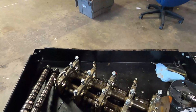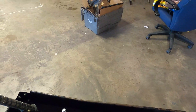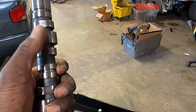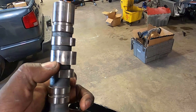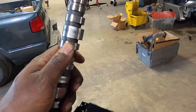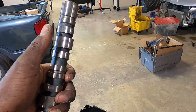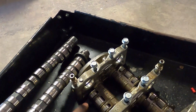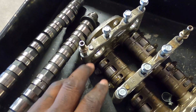For you guys that aren't familiar with VTEC — VTEC basically works off of a two or three lobe system. The lobes on the outer side are the primary lobes and this is what you daily drive on. Then once you get into a power band — most of the time VTEC is set at like 48 to 52 on these cars on stock cams — this secondary lobe activates.